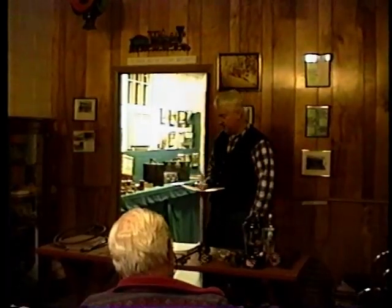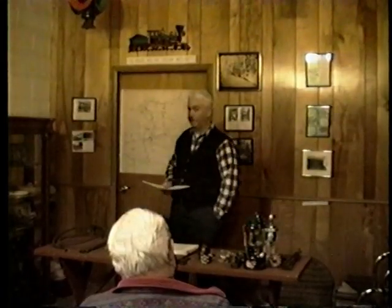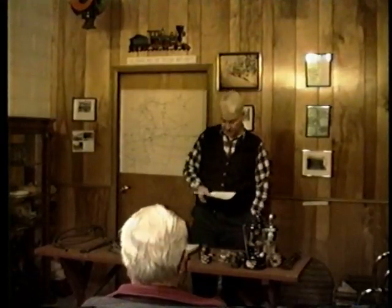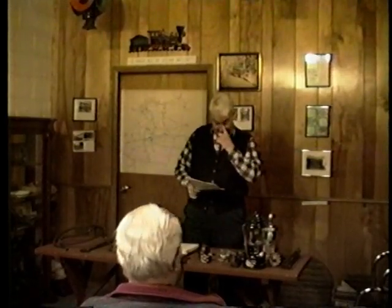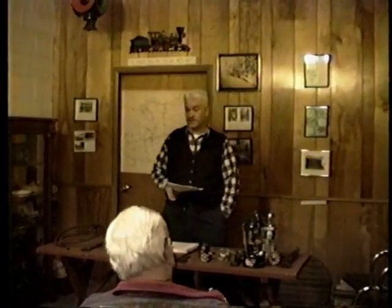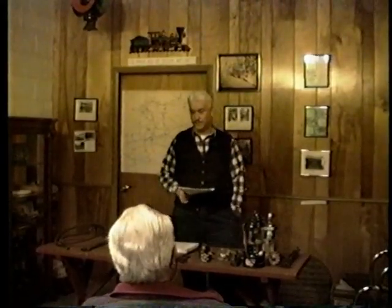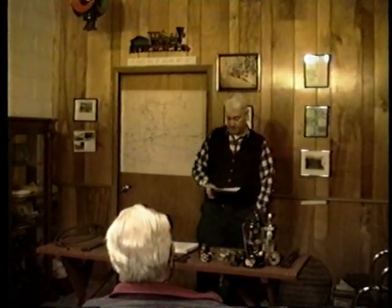The Stanley burner basically is the heart of the Stanley car. If the Stanley burner is not working right, then the car is not going to work right, no matter how good an engine or fuel system or anything else you have. So what I really want to talk about here is that the Stanley burner is of the Bunsen type. It doesn't need any electricity to fire. It's all done by first manually lighting it basically with a torch or a match, and it uses air and vapor of the fuel once the fuel is vaporized to fire.